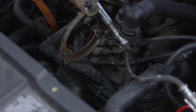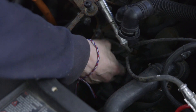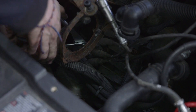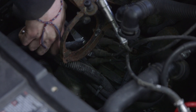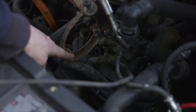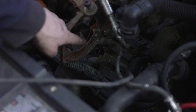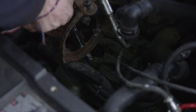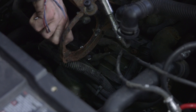We unplugged the wires before, but this is where they plug in — this is the distributor right here. We're replacing all the wires so we're just going to unplug them from the distributor and plug in the new ones. It's very important that you plug the wires into the correct spots. The fourth one plugs into the bottom, then the third, the second, and the first one on top. Make sure you know where they go so you're not running your car incorrectly and possibly damaging it.